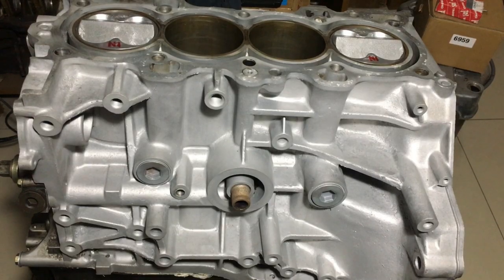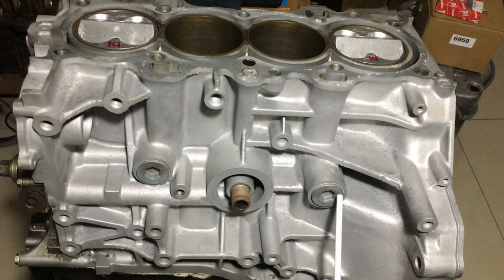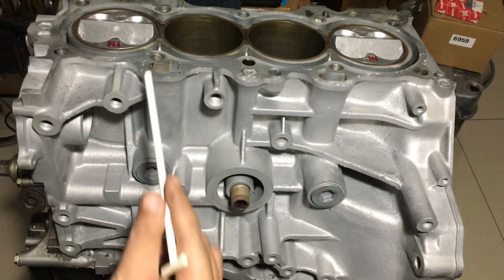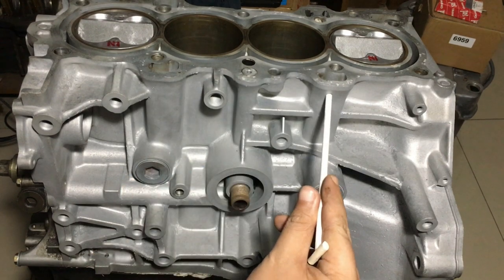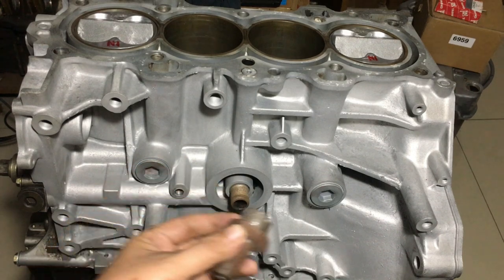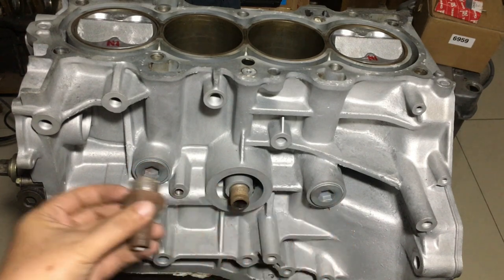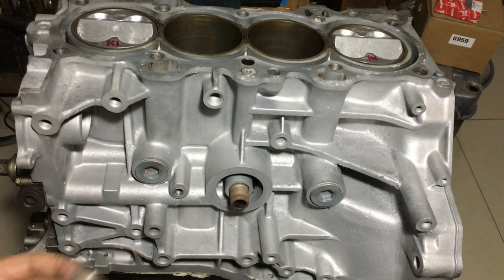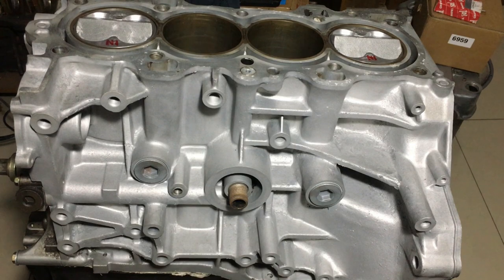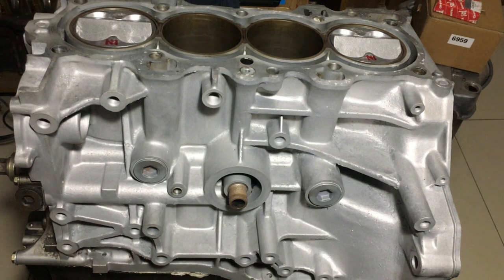We removed the 2 Allen plugs at the back by the oil drain. This way, it gets to breathe out excessive crankcase pressure and the oil drain does not get hindered. This is the fitting that we had made to install, and you can just route it into the catch can. This way, it runs more efficiently with less windage loss from the crankcase pressure. We will put captions and details on this cruise run, so you can visualize the PCV system working.